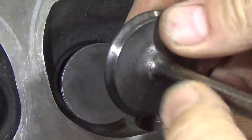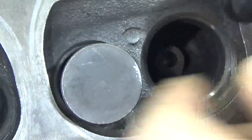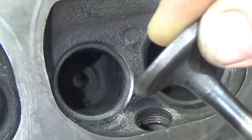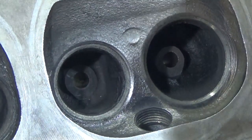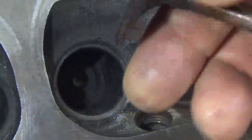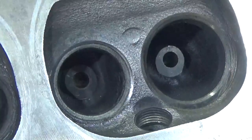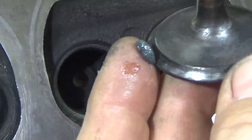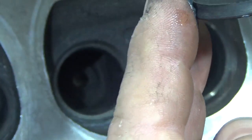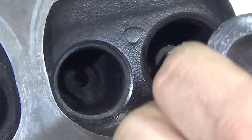The face of the valves, as you can see when I took them out, there's a lot of carbon and it's uneven. The seat's fairly uneven. Here's a valve that I cleaned up already, so you can see how much cleaner the face is. To do this is fairly simple — I'm going to do it the old school method with some grinding compound. It comes in two different grits, coarse and fine. I just take a little bit of this grinding compound and put it on the face of the valve where it's going to seat against the valve seat.